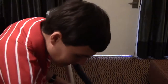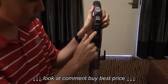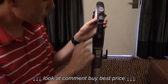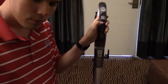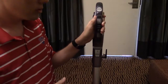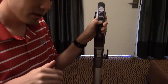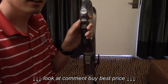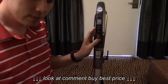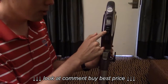So if you hear the vacuum spin up and the lights go on, you know everything's on. Next, make sure that you're in the correct mode. There are three modes on this machine: hard floor, turbo, and carpet. Make sure you're in the correct mode for you. If you're cleaning hard floors like tile, linoleum, or stone, make sure you are in the hard floor mode. You want turbo mode for low pile carpet, and carpet mode for high pile carpet. If you are in turbo mode and you're on high pile carpet, the vacuum is going to feel very heavy to push and it's not going to pick much stuff up. If you're in carpet mode and you're on low pile carpet, the vacuum is not going to run at full power. So make sure you're in the correct mode: turbo for low pile, carpet for high pile.